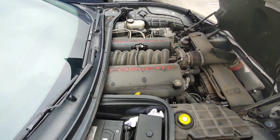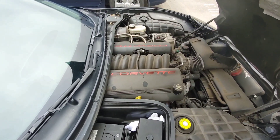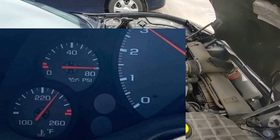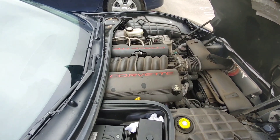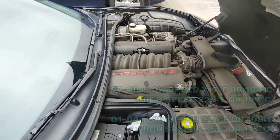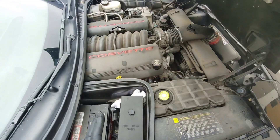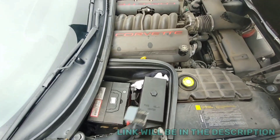I'm in a lot of forums on Facebook, the Corvette C5 forum. I always see people worried about the high temperature of our C5 when it passes the limit of 220 Fahrenheit. People start to freak out, but you have to know that the engineers of the C5 Corvette have a plan for the LS1 and the LS6 — the high-speed fan will only turn on at, I think, 230 or 235 Fahrenheit.